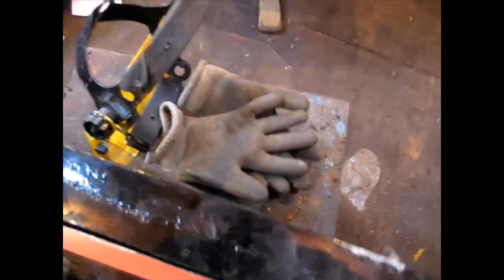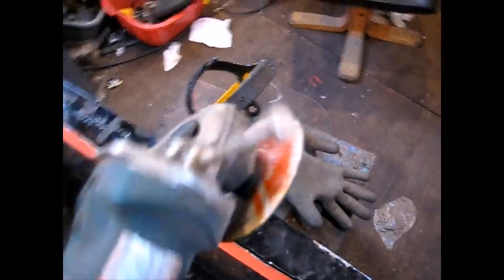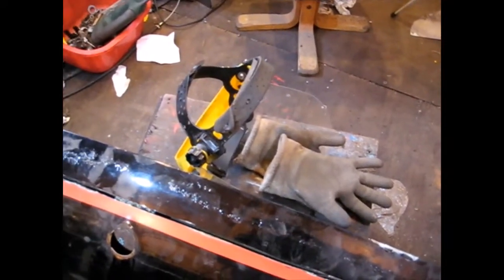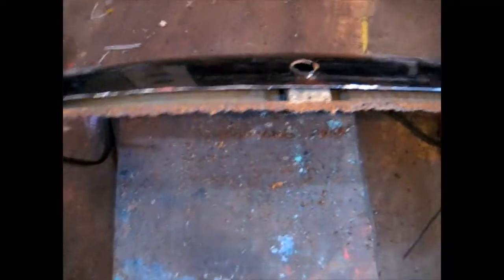Just a note: when you do it like this you need to have a pair of gloves and a big face shield. I'm not a great preacher about health and safety, but when you're using an angle grinder especially with no guard on it, if you get your fingers caught in that blade you're in trouble. You definitely need to wear gloves and some kind of goggles or head shield. Let's get this piece off in one piece and see where we go from there.